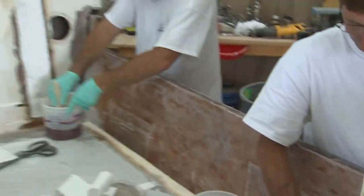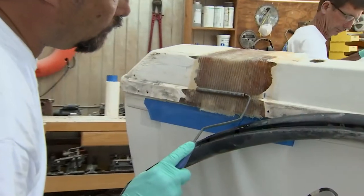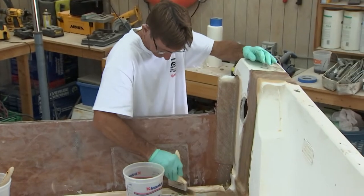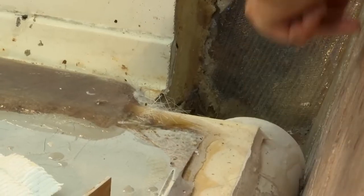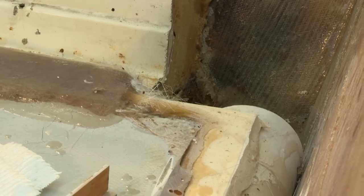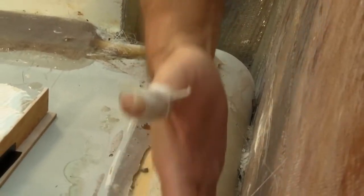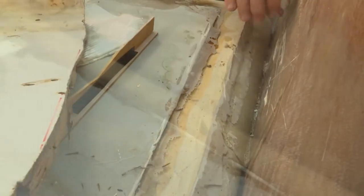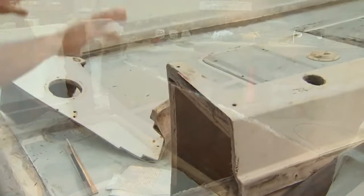We're going to have to tape it all the way around the side, all the way around this piece. I'm going to need you to graft it into the transom. I also want you to take some fiberglass from the deck — remember, it's coming onto a 4-inch PVC pipe. I would like to see you kind of glass this, leave a little splash well back here to collect water, kind of mold something nice in there as a little rain well.